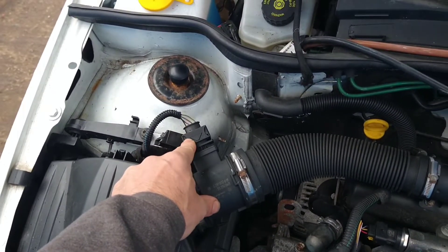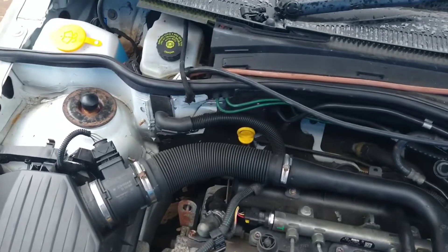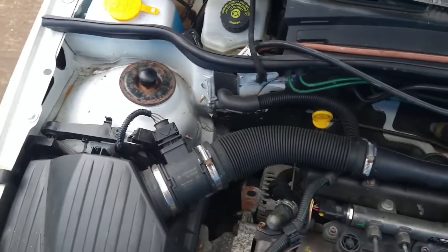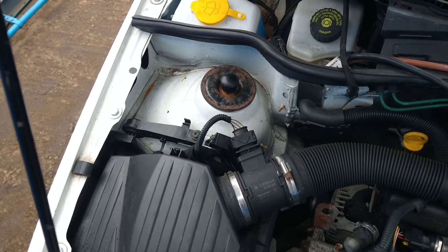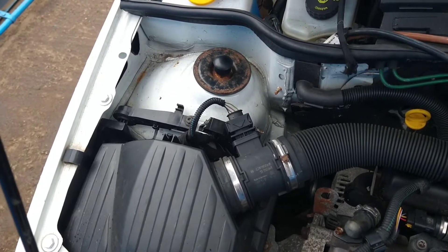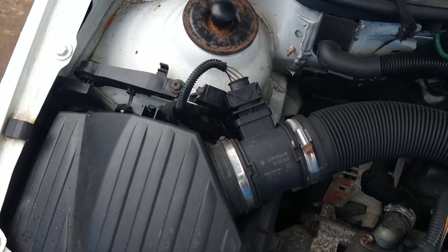Unplugging the MAF and testing it doesn't always work. I've got an early Passat — mine's petrol — and I've done a video on that one where when it was faulty, or if I unplugged the mass airflow sensor, it's not going to start. I needed to put in a sensor simulator through the wire to get it to start — it just won't start at all if you unplug it. So I had that in the back of my mind that some cars aren't going to start with the unplug test. This one obviously does, because the amount of people that said to try it. But some cars do and some don't. It certainly doesn't work on that two-litre petrol engine.